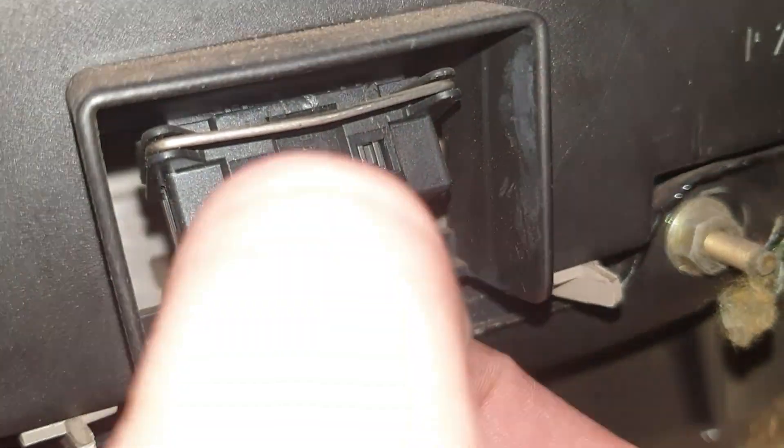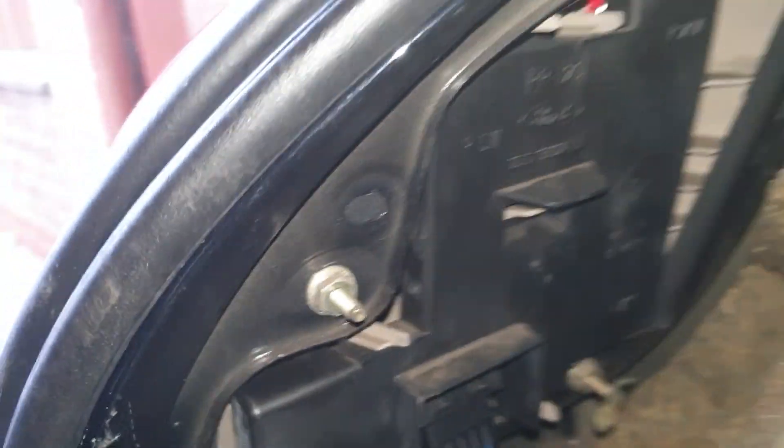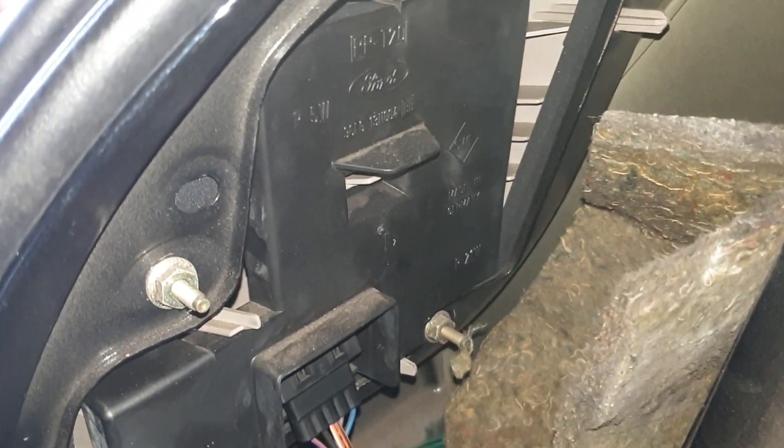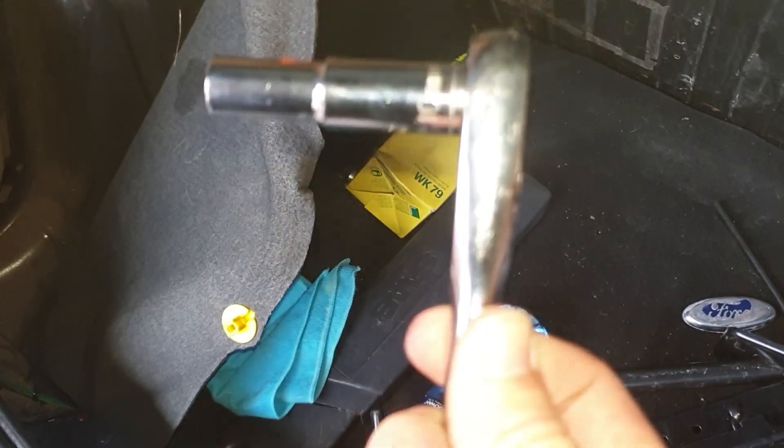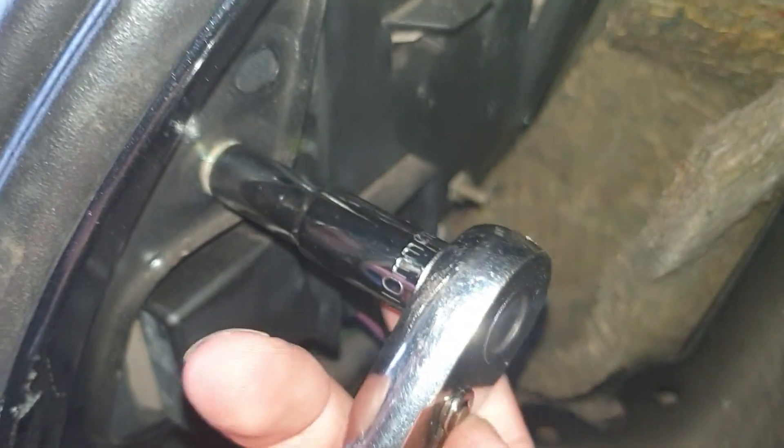It appears it would be really easy to take these off — it's just literally one, two, and I think there's another one just up there. So three bolts all in all, and then this little connector down here — I think you've potentially got to press these in to release it. Seems simple enough to change. Hopefully all the bulbs are fine in the lights I've got, but we shall find out. It would appear that these nuts are 10mm, so I'm going to use an extended socket just because of the bit of extra long thread there.